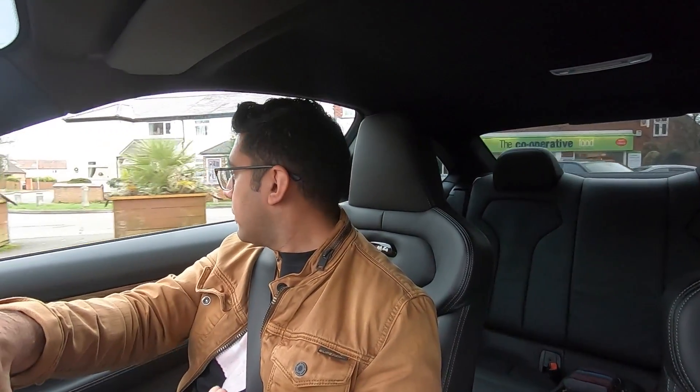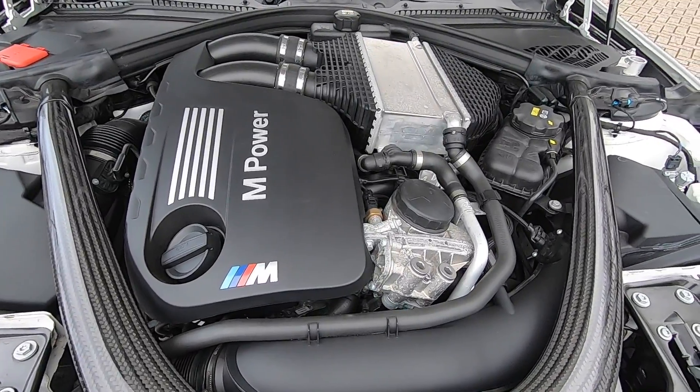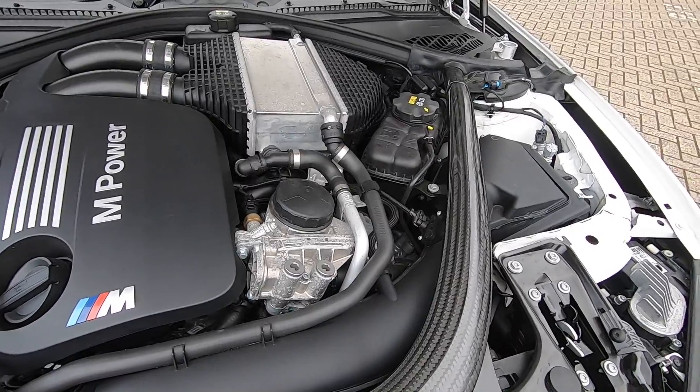Something else you can do - and I've done this - is take your car into BMW and have them plug a computer directly into the crank area to see if it's slipped. The crank hub has tolerances; it can slip up to a certain point before it throws a warning, and it does a good job of shutting off the engine and putting the car into limp mode. They will charge a diagnostic fee - for me it was a couple hundred pounds - but it gave me peace of mind. My car was still well within its tolerances; they said they wouldn't even classify it as having slipped.